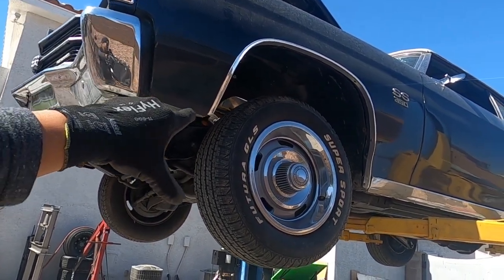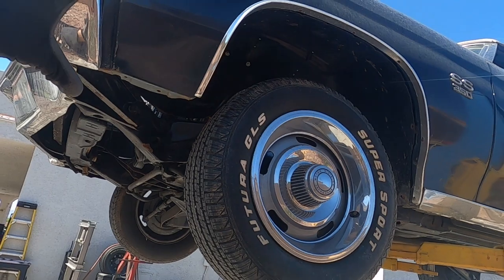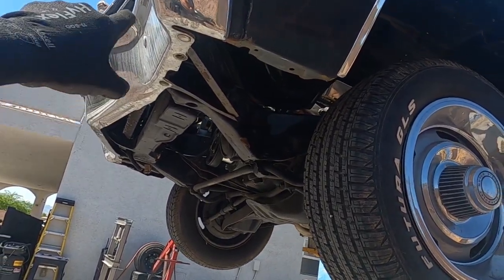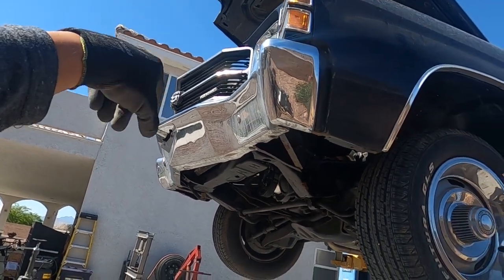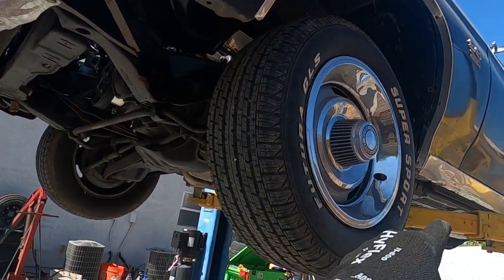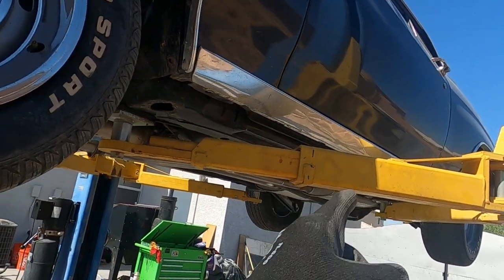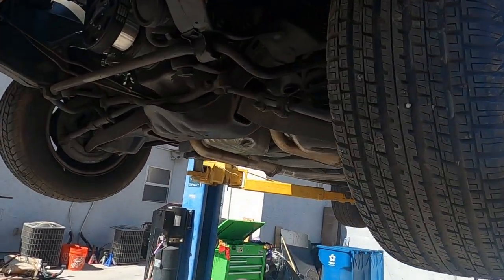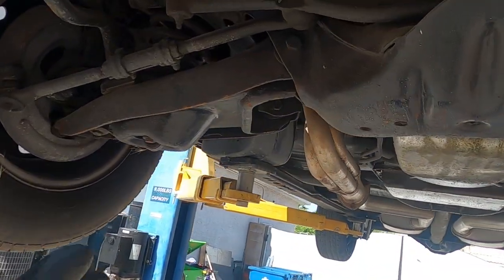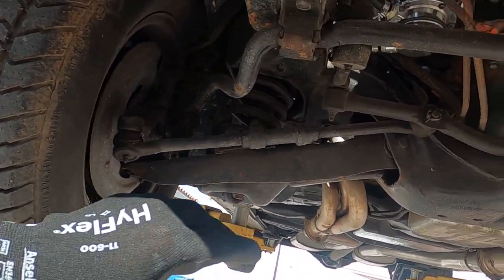There'll still be a little bit of flex, but nothing crazy. Make sure all your bolts are tight. But we're going to leave the front clip on. We've done it several times. So we got to remove the front bumper though, so that way it doesn't catch that bumper filler, grill, stuff like that. Also, the back, we're going to remove, not the back bumper, but the actual valance. We got to remove that. Trying to think of all the big obvious ones, obviously, of course.